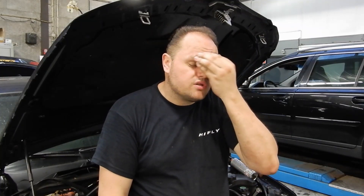I was thinking: we did a relative compression test and it showed differences between the cylinders, but there wasn't one cylinder completely missing. The differences weren't so big that this car shouldn't run — it really should run. We've got timing, we've got injector pulse, and we think we've got fuel because adding fuel made no difference. We checked the timing twice: once with cam and crank, and once with the relative compression and injector signal. So this car really should run. I took another look at the relative compression test and noticed something.